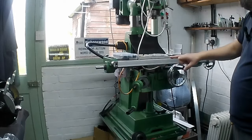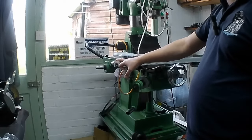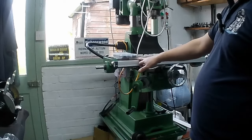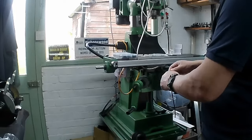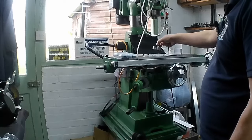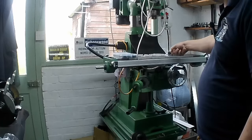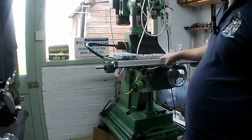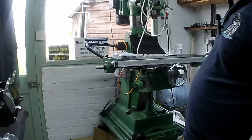And then I've got some standoff bobbins, I suppose you would call them, turned out of aluminium bar, spacing this out so that I could still use the stops, the original X-axis stops. Where's the bracket? There it is. So that's the X-axis stop that goes on there like that. A couple of screws hold it on, and the two stops themselves will still fit in there. I'm going to make some hexagon-headed locking bolts for the axis lock, and then you just nip the axis down there with a spanner just to lock it off.